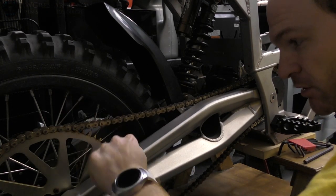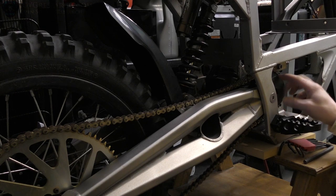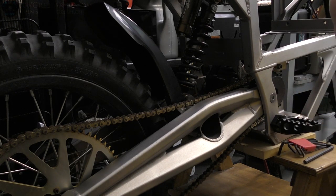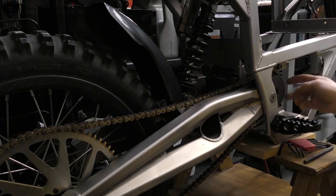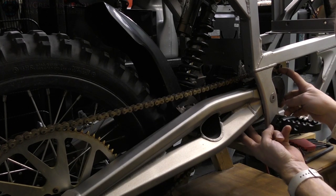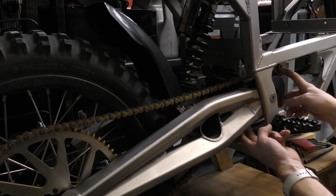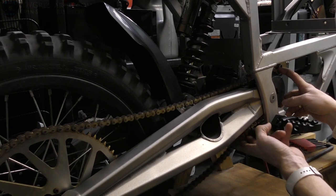The other gear that I replaced up here was actually worn down. So I cut this gear down, as you guys saw, because I apparently bought a slightly too wide gear. But it's got the right pitch so we're gonna use it. It is case hardened, which is interesting, but I think I'm okay there because I didn't get all the way through. Because I put this bigger gear on here to make this thing go a little faster with a little less torque — I wanted it to go faster on the road and not necessarily have that much torque in the dirt — the fact that I put a bigger sprocket on here means that my chain is now going to hit the frame. It's kind of hard to see, but it is going to hit the frame.